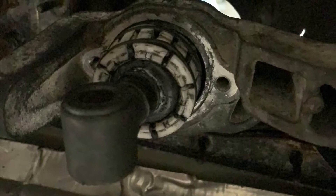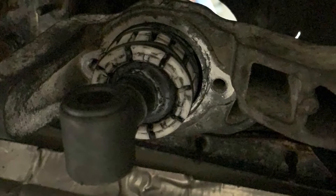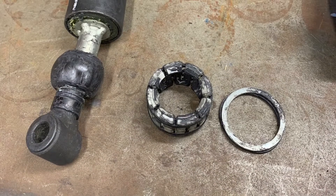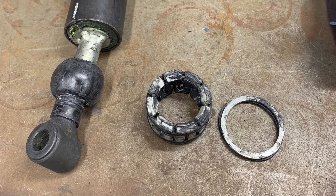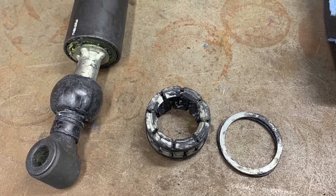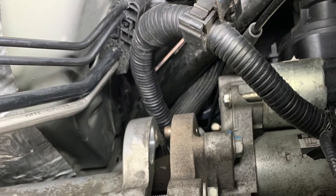So there are two main reasons why I couldn't get this thing in. The first of which was the shifter. I tried to originally put this in with the shifter still completely connected — don't do that. There's a c-clip on top of the shifter. Just remove that, pull the shifter out the top, and then you can get the trans lined up correctly.